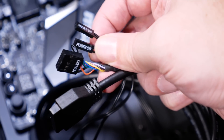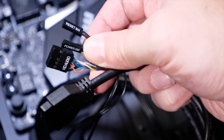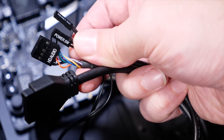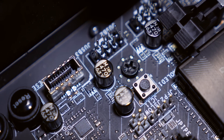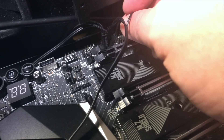The next easiest thing to do before things get too cluttered is connect the front panel stuff. This is usually the power switch and light, the reset button, the hard drive activity light, and the front panel USB and audio jacks. These are almost always a pain — they're very small connectors that mount to little pins on the motherboard. If you have big hands, you may want to get needle-nose pliers or blunt end tweezers to help.